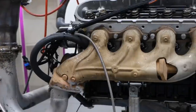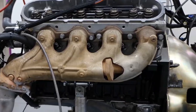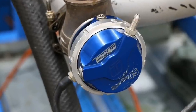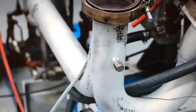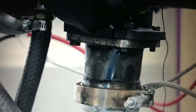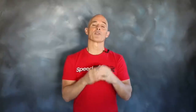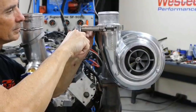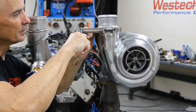That thing was topped off with a factory truck intake, a manual throttle body, and a set of 80-pound Excel injectors. All of this was controlled by a Holley HP management system, which is what we used to dial the timing back from 20 degrees to 12 degrees. Boost for our little 4.8 was supplied by a custom turbo kit consisting of a pair of truck manifolds reversed, facing forward, and feeding a custom Y-pipe. The Y-pipe featured a pair of TurboSmart wastegates and a 3-inch V-band flange, allowing us to mount any turbo we wanted using adapter tubes that adapt from the 3-inch V-band up to a T4 or a T6. In this case, for our test, we mounted a T6 S475 from Summit Racing. The S475 was capable of supporting over 1,000 horsepower, so it had no problem with our little 4.8.